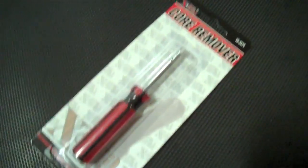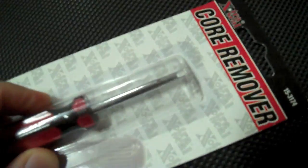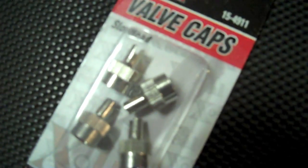That'll at least buy me another year. So I celebrated by fixing my motorcycle tire. I'll show you that if you want to see that process. Okay, cool. So here's what I got. I got this core remover — kind of like a screwdriver, but it has those two little prongs on the end and a little hole down in the middle. Basically what that does is it pulls out the valve core from that little stem right there. And we've got some valve cores here — that's what they look like. And then just in case something goes wrong while I'm out and about and don't have access to this tool, I got some valve caps. They actually have a similar prong-type attachment on the valve caps themselves. So I'm gonna go ahead and pull the core out of that back flat tire. I'm on a KLR650.